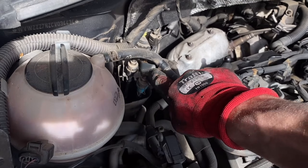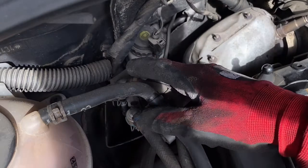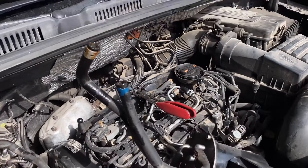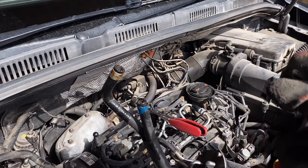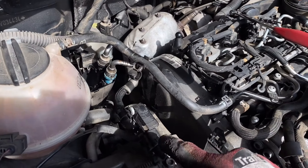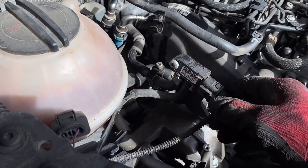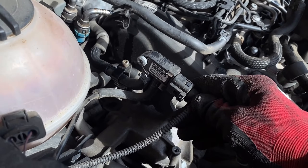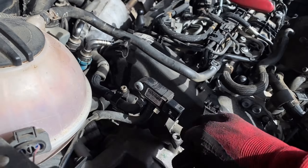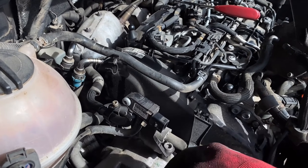I'm going to get these spring clips off two pipes and lift the whole housing out of the way. Fuel filter housing is out — you squeeze the clips together, wiggle the pipe whilst pulling it off. I've leant that over to one side. Now I want to get this DPF pressure sensor off and hang it over near the turbo. The way you do these clips is: push the clip on the little tab on the end, finger under it, and pull it off.